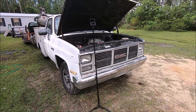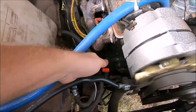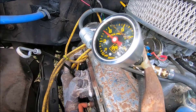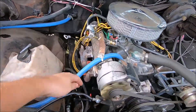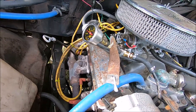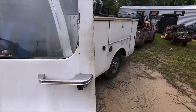Why does it matter which one is bad? Let me show you. Since we've got a shutoff valve, I can shut this valve off. And you can see the pressure slowly climbs up into the 5 PSI region. If I open it again, it'll drop back down. Now I've got the valve shut — let me shut the engine off and show you what happens.